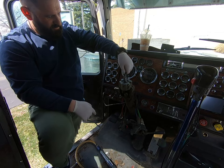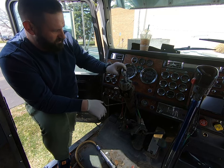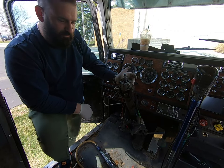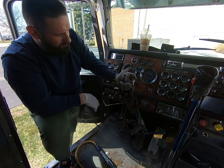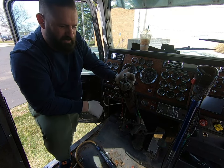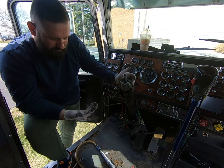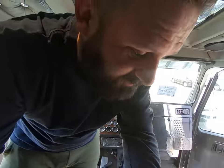Yeah, that's what does it - the play inside there now is just incredible without those pieces on there. So I'm glad it's gonna be an easy fix. Now I do have to fix the threads here on the steering shaft. I hit it a couple of times trying to get it loose a couple weeks ago, and I left the nut on there - or so I thought - but it wasn't on there good. I'll just hit that with a file a little bit just to get them started. I'll do that another time. But since I'm here, I'm going to take that rear couch off because that thing is just messed up.